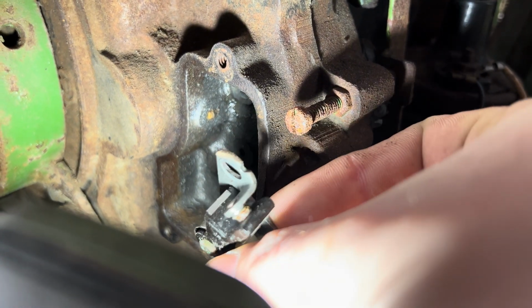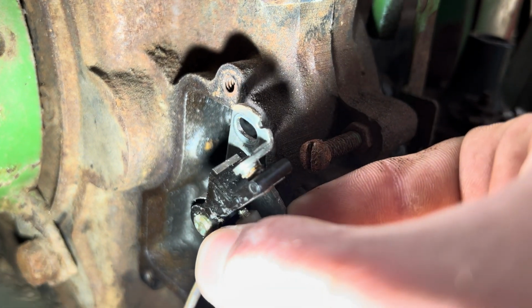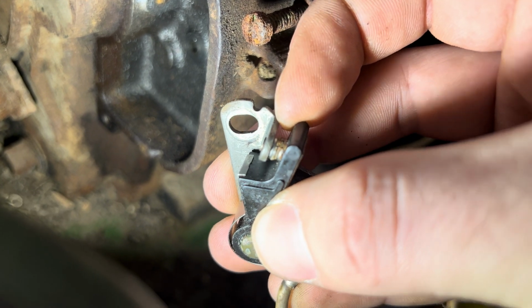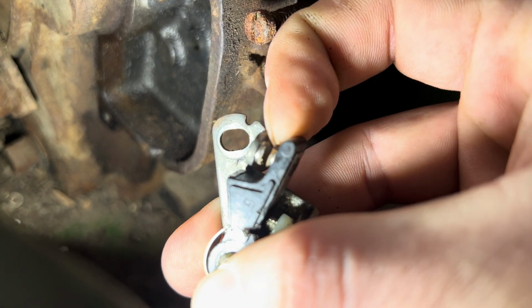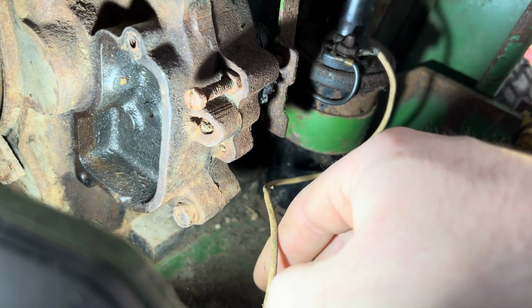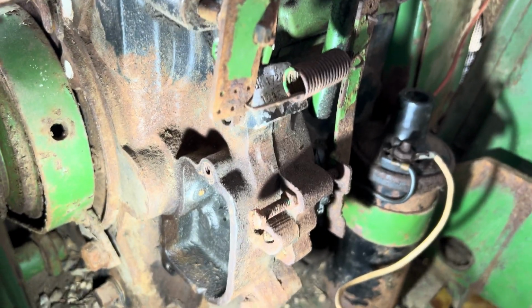It would sit in the machine like this. There's a rod in there, and there's a little hole, as you can see there, where that guy sits in. And there's a screw hole up on the top there that holds him in right about there-ish. That push rod will actuate against that piece of metal right there, and it will separate the two, creating a gap for the spark to jump across, which then allows the spark to travel to the coil and therefore go through the coil wire to the plug where it fires in the engine, and voila, you have spark.